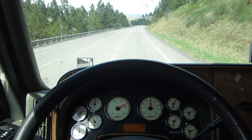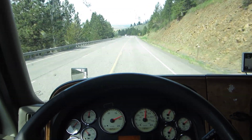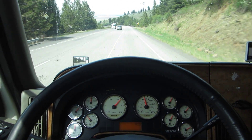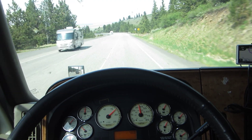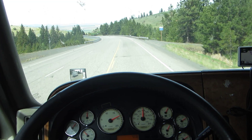The truck is going up to 45 and snub it down to 40. There you go — release brakes, let the truck coast again. And between these snubs, the air gets to cool those brakes down a little bit.